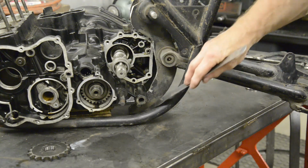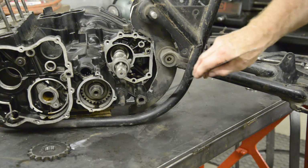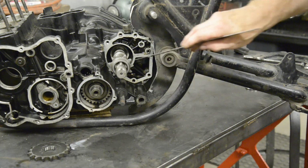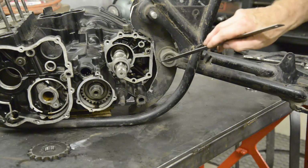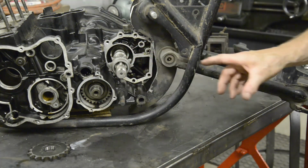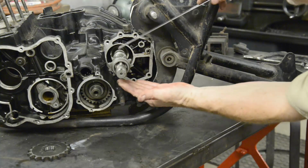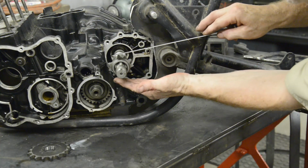But with this hole in the plate going to be here, as I was originally planning, the sprocket line to this pivot point to the back wheel, this was right up here. Now we're only going to be able to get a small sprocket on here, and because of that we're going to need a small sprocket on the back, so we're not going to have a huge amount of angle in the chain. It's going to be very much more like that.